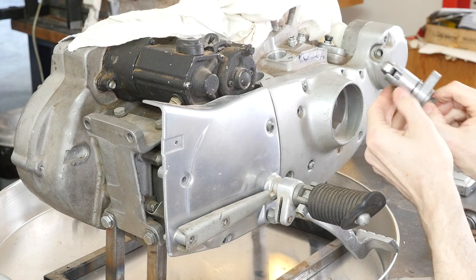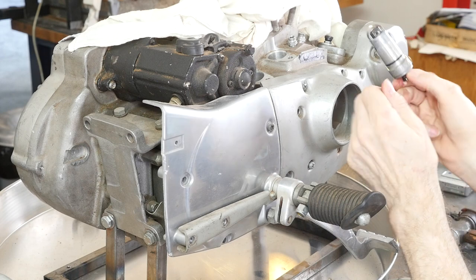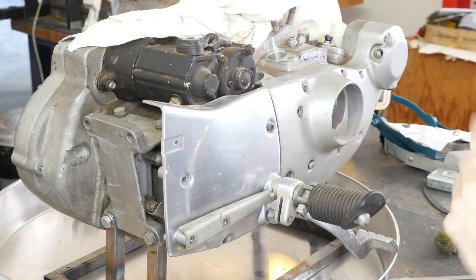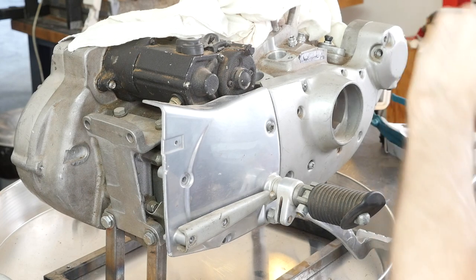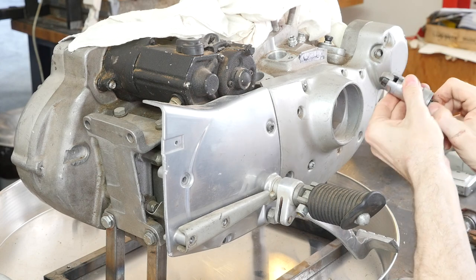Oh, look at this. See, that looks like a piece of silicone. See, people do this. Oh, you can see they siliconed here. That's usually because it might be weeping from here, and they put the silicone. You can see the silicone's getting in the engine. It could blow up the engine. Sand will be ground up by roller bearings. Silicone will skate that bearing, turn it blue, and weld it into one piece. But why is this not going?